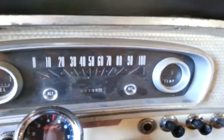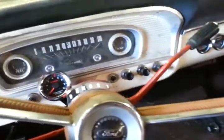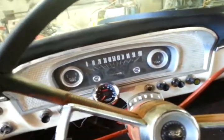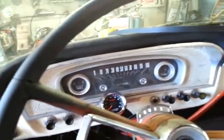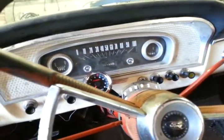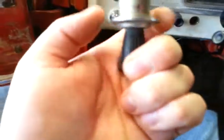I got all the turn signals working. They've only got one indicator for both turn signals. I got an electronic flasher in — that's why the four-ways go faster. I want to get another electronic flasher for the other ones, and then if I get another electronic flasher I could potentially put LEDs in, which would be cool. I would have bought two of them but NAPA only had one that day.